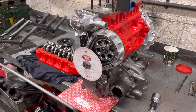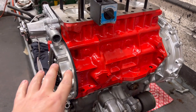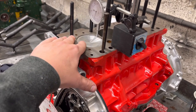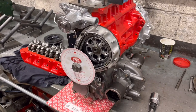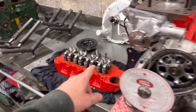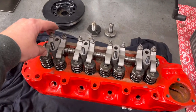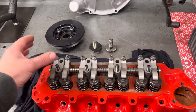Here we have the Mini, and as you can see a lot of progress has been made. The block has all been pretty much built up — we've got the full balanced crank assembly in the block, the rods have all been sized and balanced with the new pistons on. We've made sure that the piston protrusion is level with the surface of the block, which has been faced, bored, and all clearances are right as they should be. We've got the new uprated camshaft that runs in the block, and the cylinder head which has all been reconditioned — it was unleaded anyway but we've got the uprated valve springs, new rocker shaft, and the rockers have all been reconditioned. We've blasted these, faced the pads underneath and re-oiled it — all the bushes are perfect, so that's all good to go.